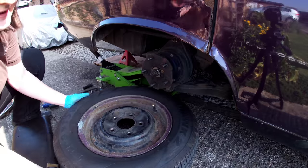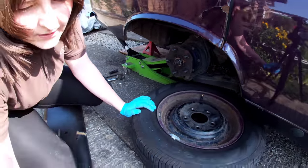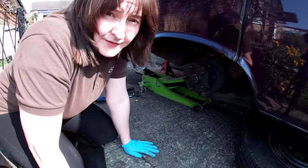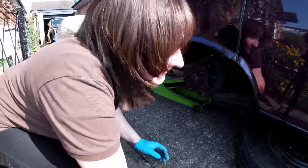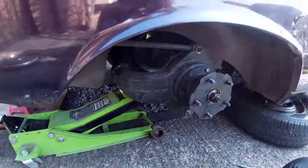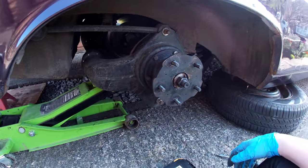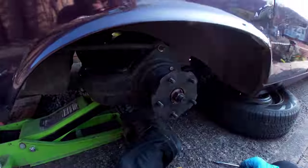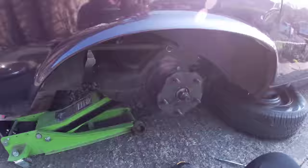What I do with the wheel is lie it under the car, because then if the car does fall off the jack and the axle stand it will land on the wheel — not ideal but it's better than it landing on you. Even though we've got three supports here, I would still try and avoid putting your limbs underneath. Limit what you stick under there.